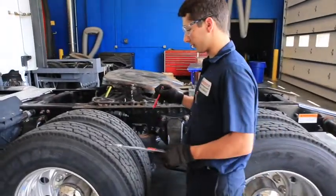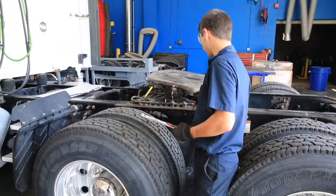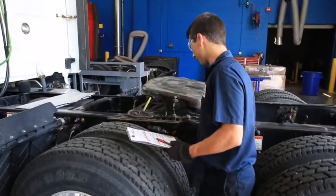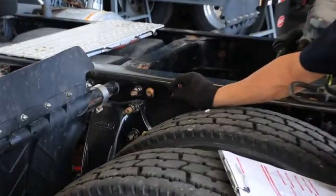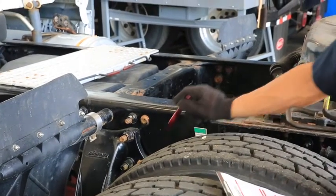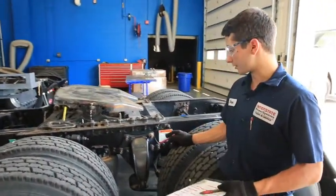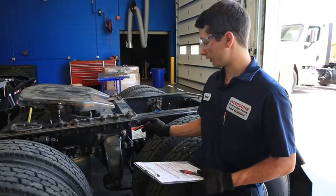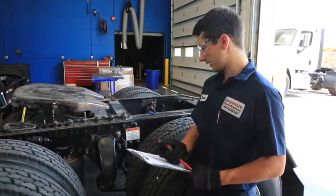When you get to the duals, make sure there are no obstructions between the tires and that from the frame clearance nothing is rubbing or can touch the tires going down the road. Going to the inside, check the suspension — here it's the front leaf hanger — make sure it's fully secured to the frame rail with all hardware present and no shiny threads. On the back, this truck is set up with air ride suspension. Make sure the air bag is not ripped, torn, or showing abrasions or bulges indicating a leak, and that the hardware on top and bottom shows no signs of looseness.